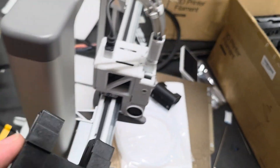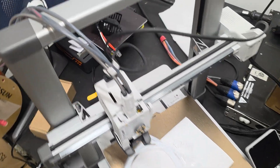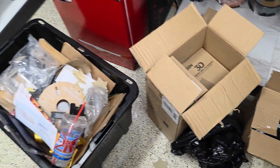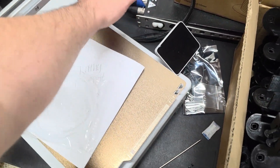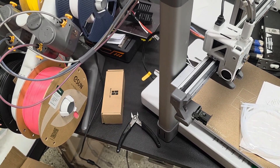Wait — what is this? What the heck? They've been operating this thing with these on? I just noticed — those definitely should have been removed. I can only imagine they were causing some friction. Look at the scraping it did! Had no idea. They accidentally left on the shipping brackets — totally unnecessary. Let's make sure there's no foam underneath either. Alright Kathy, we'll get you your printer back better than the way you brought it in — and in more ways than one.